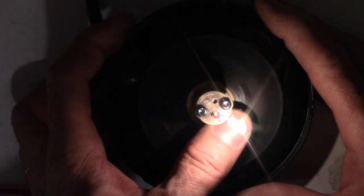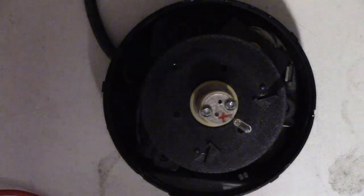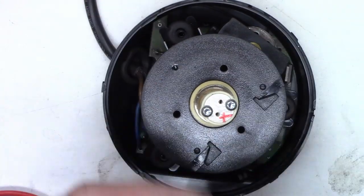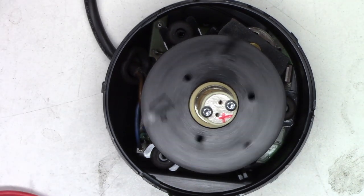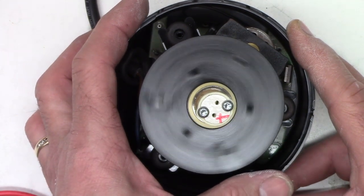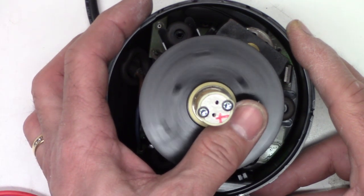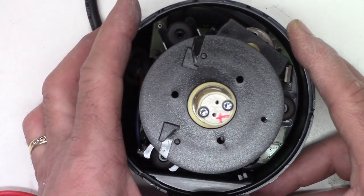The way it does that is it uses that light to pass through these little holes in the turntable, and it measures the speed that it passes that LED receiver. So when I block that sensor, it times out and shuts off. Even with the recording lights on, if I block that sensor, it still shuts off.